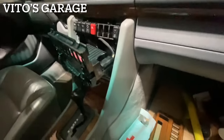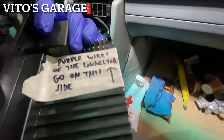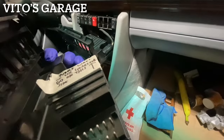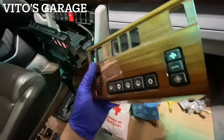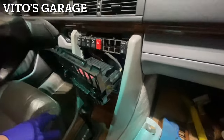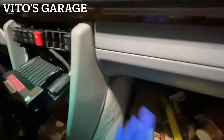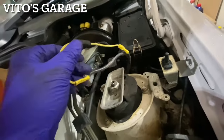Someone has been messing with this before. I want to disconnect this climate control — I'm going to use this one here, the one I did some markings on. This is the one we're going to use on this car. I'm pretty sure this one is fully operational. I'm going to install this actuator — it's used but in good condition — because the one that's over there was messed with. I just want to get this thing back properly.